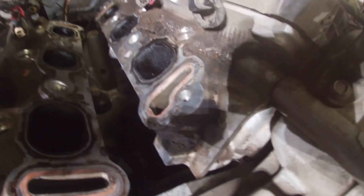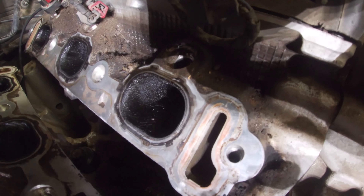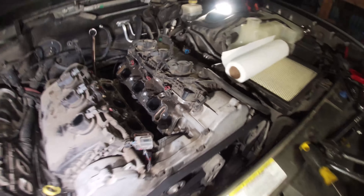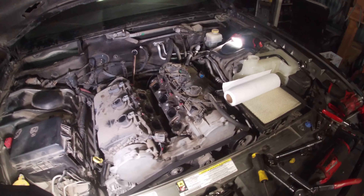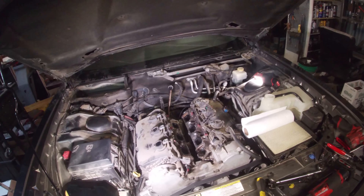When you go to replace your gaskets on your intake manifolds, these surfaces have to be as clean as possible. Shove paper towels down into your intake valleys to fill those holes as tight as possible, then go through with a razor blade and brake cleaner to get the surface as shiny and clean as absolutely possible. Then put your new gaskets in — do that on both sides. The upper intake is plastic so that one will just pop out and pop in.